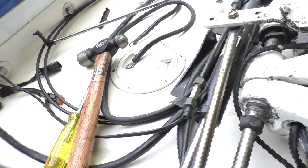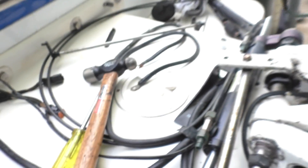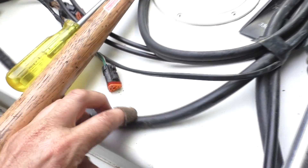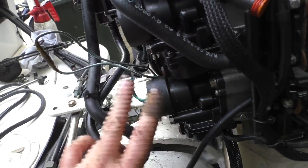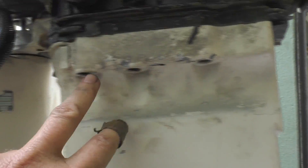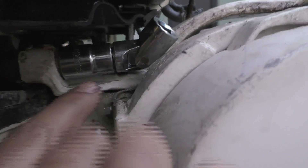I drained the carburetors and all the fuel was very distinctly coloured exactly the same as the two-stroke oil that came out of it, so it seems to have had oil in the carbs at the time. I've taken the main mounting bolts out — six bolts from under here — and then there's just a handful of little three-eighths bolts that also hold the power head on.